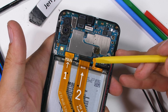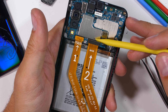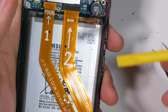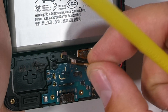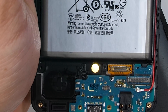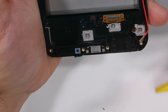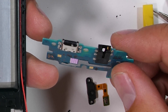Now let's take a look at the phone guts. I'll unplug the battery connector — it just snaps like a little Lego — and then I can move over to the long extension ribbons, which also unplug like little Legos, both of which have arrows pointed up towards the main board just in case we get lost. Down at the bottom, we have two little screws holding in the optical fingerprint scanner. This is one of those good types of sensors with a lens on it. The sensor inside the Nokia 9 was one of the slower first generation under-screen scanners without a lens, and they just aren't as quick without it. The charging port board is down here as well, glued into the back side of the screen. It has a water damage indicator on the back, along with a USB-C and a headphone jack.